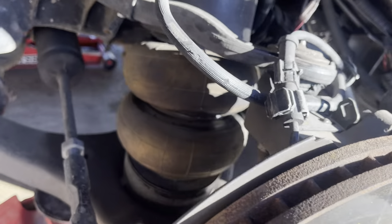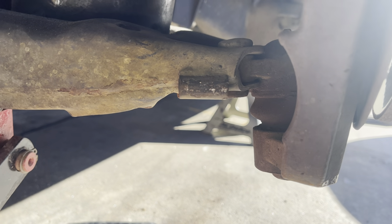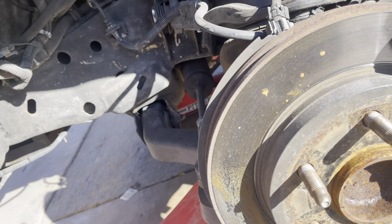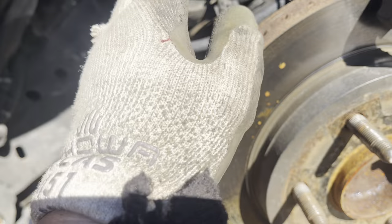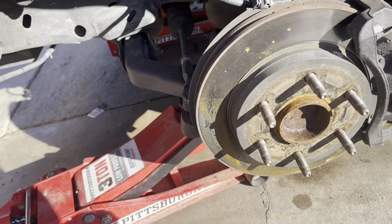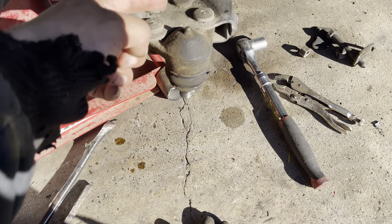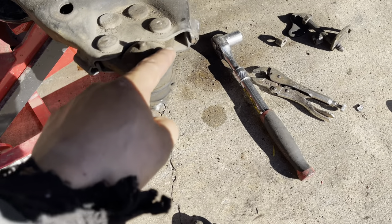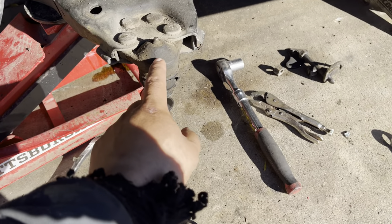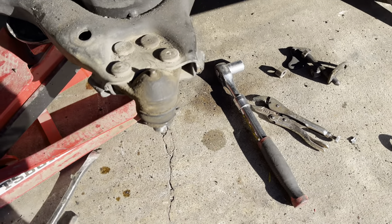As you can see, the upper control arm goes there — that one's shot. See how it goes in the bottom? Right now I'm going to show you how you flip it — it's going to create the camber correction, make it straight. I'll take this apart: take the caliper, the line, the ABS sensor, the inner tie rod, the outer tie rod, the upper control arm, and the lower ball joint. To take these rivets off I'm going to cut a little slice everywhere, hit it with the chisel, smooth it, drill it out a little bit, and then punch them down.